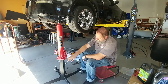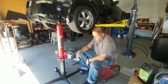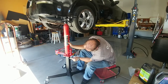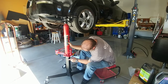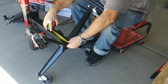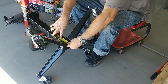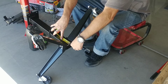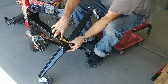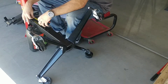What it's looking like is I've got to get this flat plate to sit pretty much right on top of this, and that's with me using the five and a half inch extensions to get the car higher. I'll just go that far down and I'll have to drill three holes in it to match the base holes, so drill those holes in there and then just mount this right to the base. About two and three-quarter inches — I can leave it a little longer, got a little wiggle room. I can go like three inches and then set it down and mark the holes.